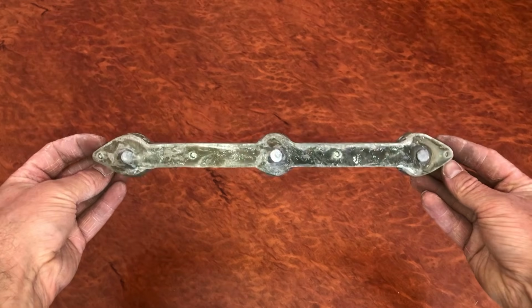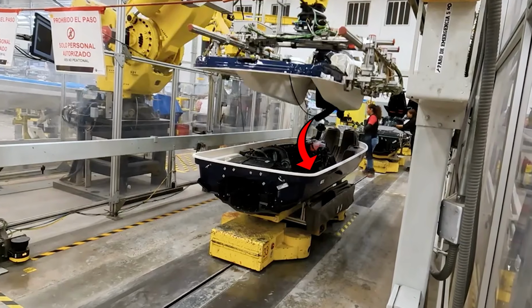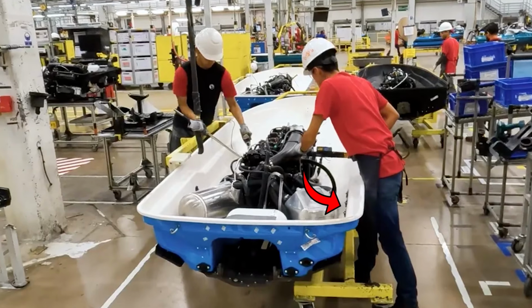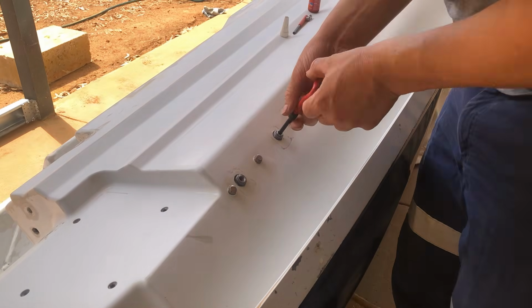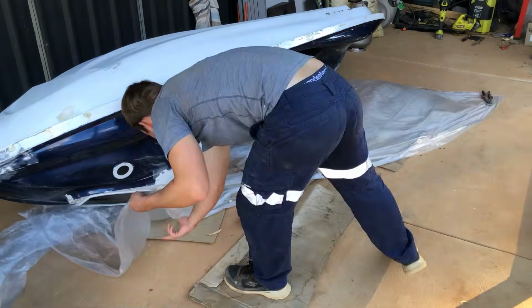Now, after some basic cleanup and drilling the holes, it will never snap again, so I put it back inside the hole with the rubbers it came with to seal it again. Then I filled the cavity with expanding foam again and re-fiberglassed the hole that I cut so it will never leak or get water in it. But it was all too hard to film and show in a tight space inside the back of the Jetski, but now with some new helicoils tapped and inserted, that piece is done.